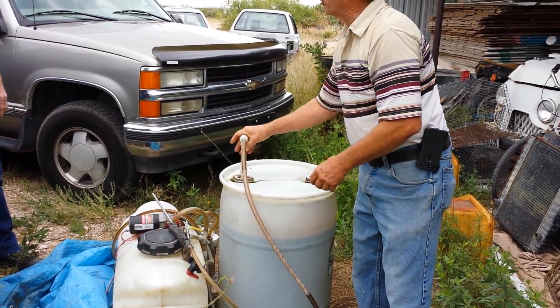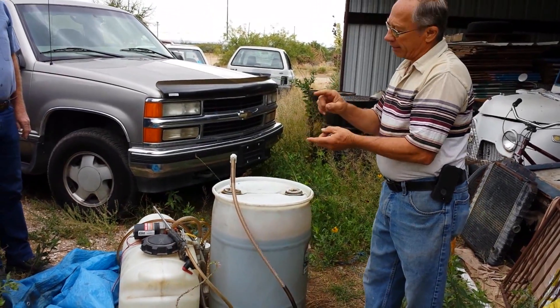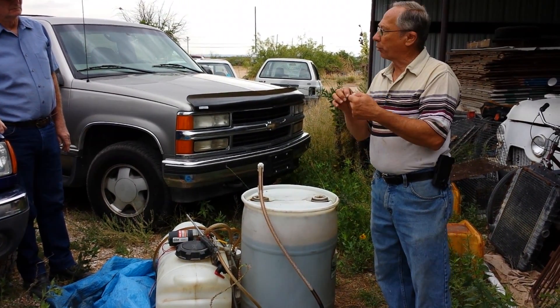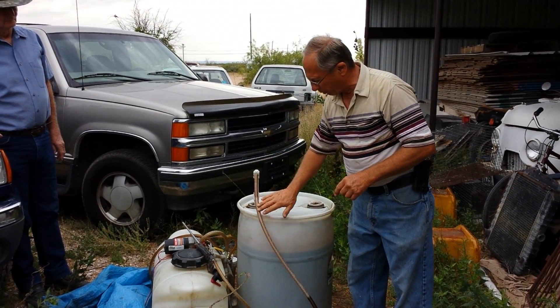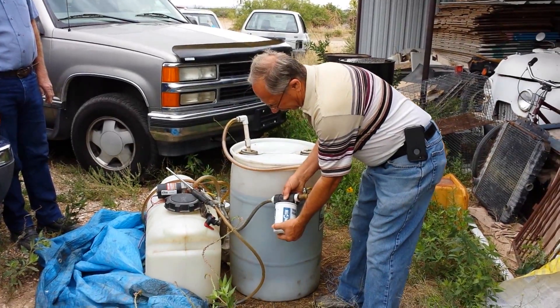Let's open up this cover and see what we have. This is our canister of used motor oil. This is a PVC pipe with a cap on the bottom of it and we've got a paint net around the top of it. About six or eight inches above it we have holes drilled into it so that the heavy stuff will settle to the bottom, will not go through the net, and will not be higher than the holes — that way we won't get it in the line.